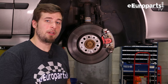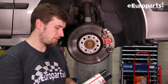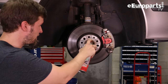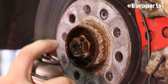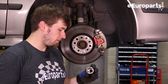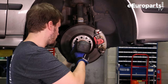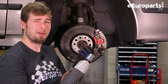When I took the wheel off, I found out that the axle nut is super rusted, so I'm going to use a product from Wurth called Rust Off — this is the extra version with PTFE — and we're going to soak it for a little while, get it nice and wet all over. After about 10 minutes of soak, I'm going to use an inch-and-a-quarter or 32 millimeter socket to try to pull this off. That's why we use impact.